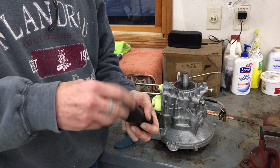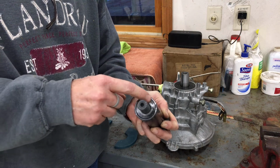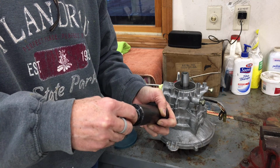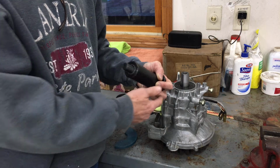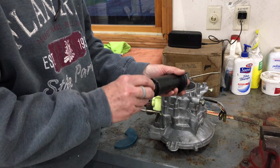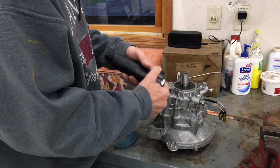I would strongly recommend greasing this threaded shaft, and ideally maybe finding a bearing to slip over here, and the nut will tighten against the bearing, and then the bearing will press against this collar, because when you get this sucker under torque, it pulls hard. So anything to ease the tightening of this pulling action will greatly enhance your success rate.